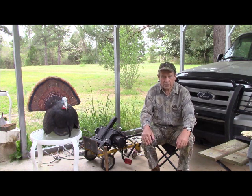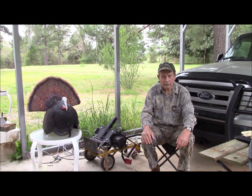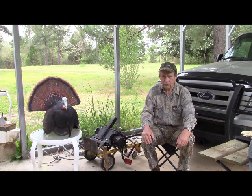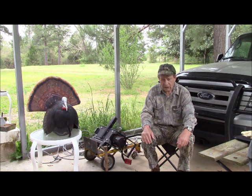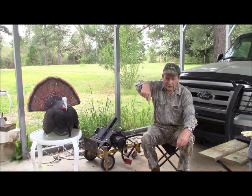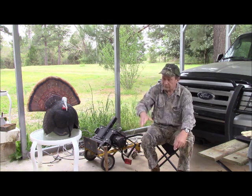But then, this spring, I started to pull some trees with it, which I commonly do, and the cable was having problems coming in and out of the spool. Very unusual. So I reeled the cable off the winch to take a look to see what was going on. And as you can see, there's a piece of jagged metal from the bottom of the control box that is hanging down like this, and binding up the cabling as it's spooling in and out.